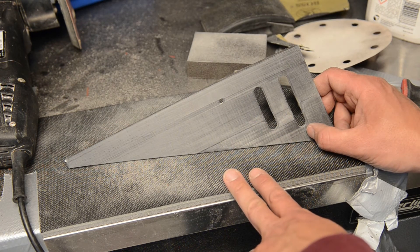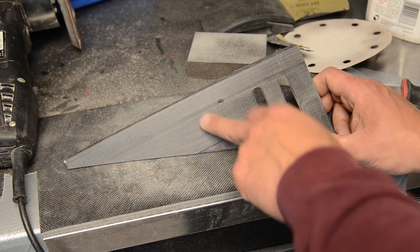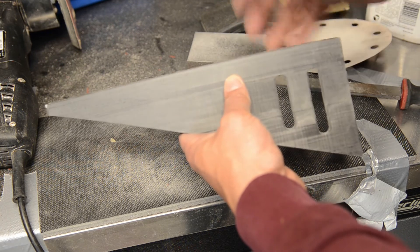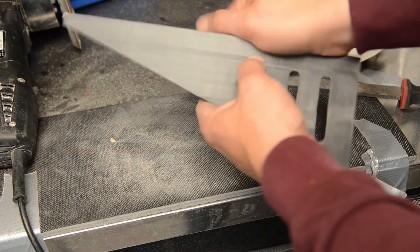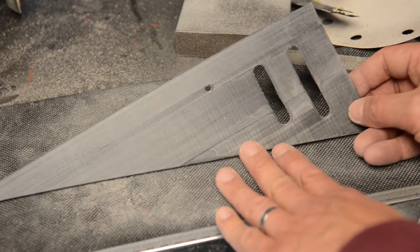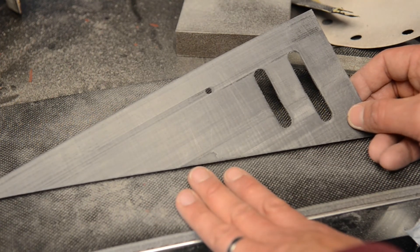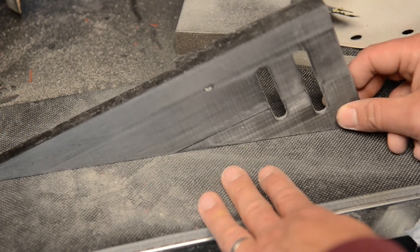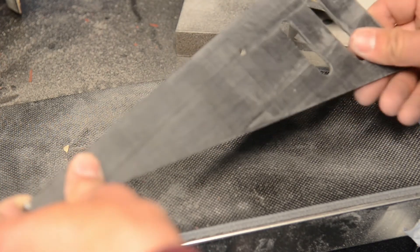I'm definitely going to use 3D printing for all of my brackets, just to tidy up that tray and make sure everything has a place. I'll also have to use it for the other side of the fairing — I've got one either side. I'm going to do something here just to cut it out or make it look nicer, because that's where it bolts on. There's another bracket on the subframe that this sits flat onto, so I only have one fixing point but it'll lean on the other. I like it, I'm definitely going to use it again for anything practical that doesn't need a final finish. You just leave the machine at it and it'll print. I'll leave you with a quick time-lapse of this thing getting printed.